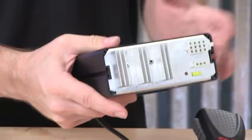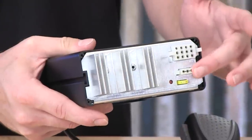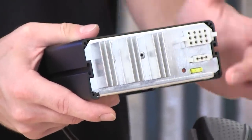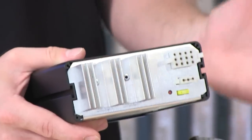There is a push button inset on the back aluminum cast housing heat sink fin system, and that is a scan lock push button. So when you're going through programming the siren tones, it's very easy to do — just take a small screwdriver, pen, or paper clip and push the button as needed, selecting different tones.